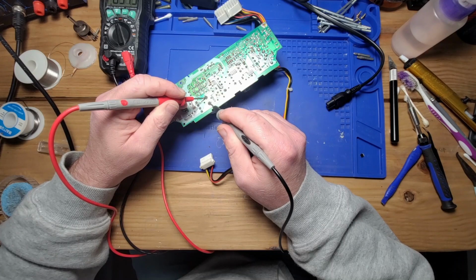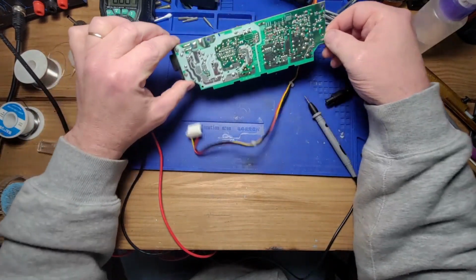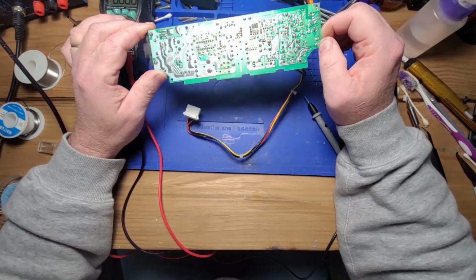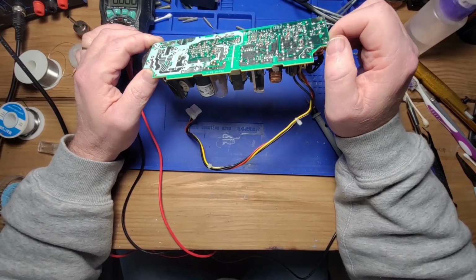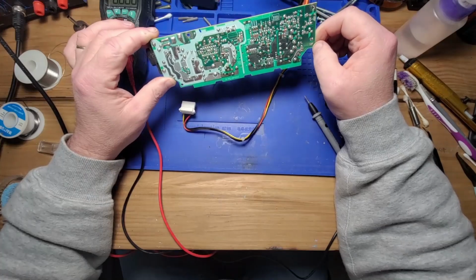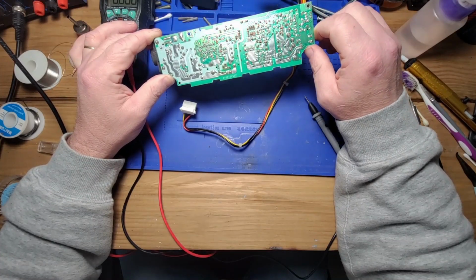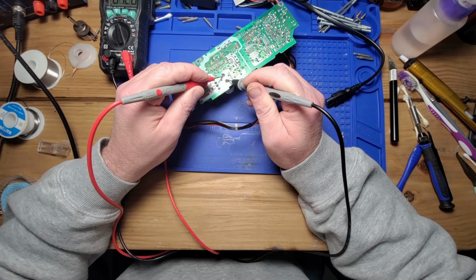So we know that then the rectifier is doing what it's supposed to do. We know that that big cap is holding a solid steady charge, but why wouldn't I have the 3.3 volt standby? The chart says it's supposed to be in both. So why would I not? And what is that wire sticking out there? I need to order a capacitor discharge device if I'm gonna be doing this. I don't think it's really safe otherwise. It's too bad your multimeter didn't have a quick discharge function or something like that.